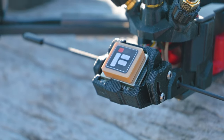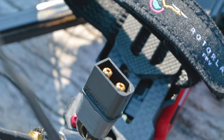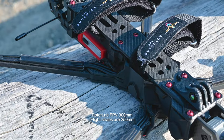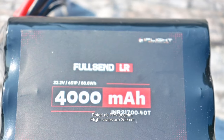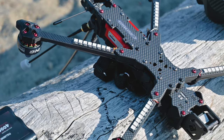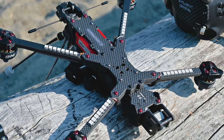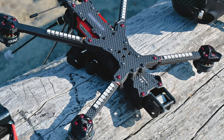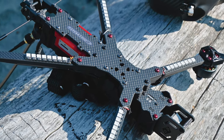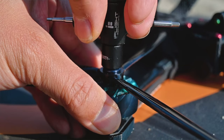The Chimera Pro comes with a really good GPS unit — one of the best I've ever used. It locks onto satellites very quickly. I use kevlar battery straps from RotorLab FPV; they're perfect for holding a big battery since the iFlight ones are a little too short. Some customizations I've done: I added 8-chip LED arm lights adjustable in color, and changed all the screws to 7075 aluminum, which saves 20 to 25 grams. It gives it a really cool stealth bomber look.